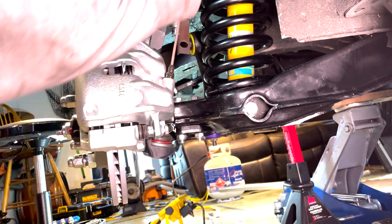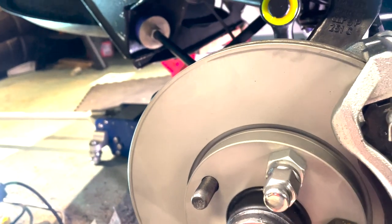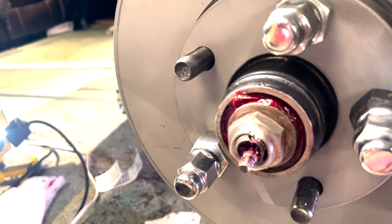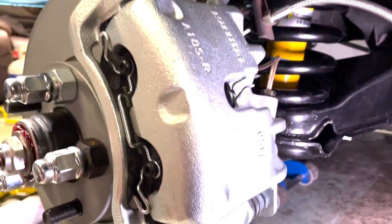I'm going to have to bend the brake line around this way so that it will hook up in there, and then the braided brake line goes from here up to the top. I think I've got this all figured out now — thanks so much to everyone that weighed in. I've routed it nicely using the existing bracket, and it all ties in up here with no crazy bends or kinks. The only thing I'm a bit worried about is this fitting, which seems just a little bit loose. I can move the washer in there, which I know I'm supposed to be able to do, but once I whacked it into place it seems maybe a little looser than I'd like. I have a feeling I'm going to be replacing that nut. Let me know your thoughts.